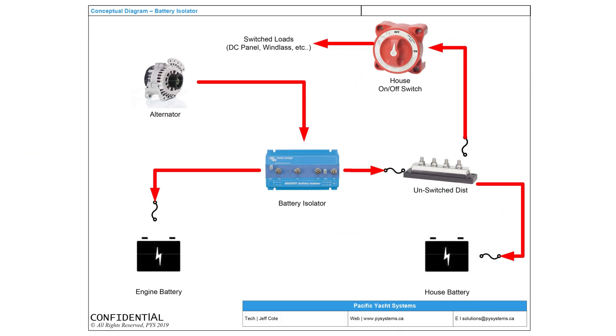That's always been my hesitation. Not to say it's wrong, but what's the win of choosing a single battery isolator for both? I understand it's doable, I just never understood why you would take the risk. Normally we run the alternator to the battery isolator, and battery chargers — many of them have multiple output leads, like two or three — we run those respective battery charger leads directly via fuse at each respective battery. So the battery charger system is completely independent from the alternator system.